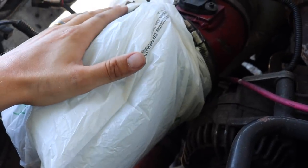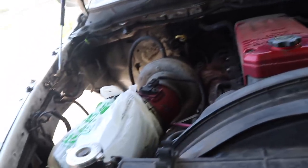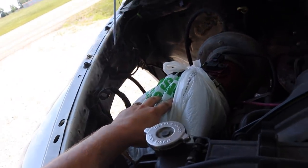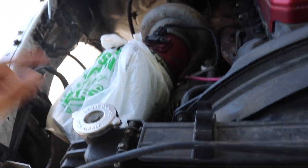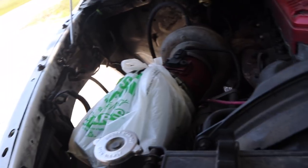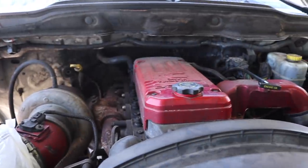I put a bag just now over the intake because we're going to do a little bit of pressure washing and cleaning under here. I just don't want to get a bunch of water on the intake so when we start it up it doesn't suck water in. When you're using pressurized water, better safe than sorry. You don't want to damage anything. I might even take the air filter off, pressure wash it to clean it up because it looks pretty dirty, then dry it and put it back in.